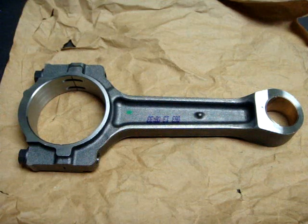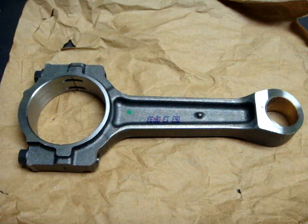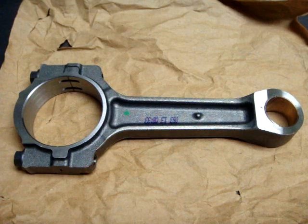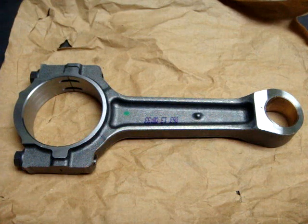The LSA connecting rod uses a rather industry standard of manufacture, and that is pressed powdered metal sinter forging. What that is: powdered metal is poured into a pressure form and compressed very highly into an initial workpiece. That initial workpiece is then ejected from the pressure mold, taken to a furnace, and heated to cause molecular bonding between the metal particulates within the initial workpiece.